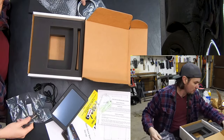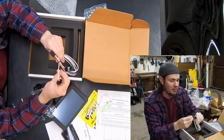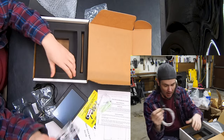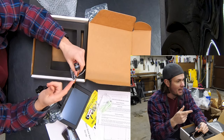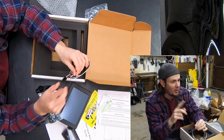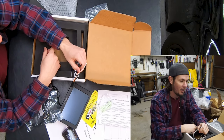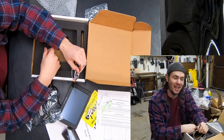What's different between the CAN adapter that's in the car and this one is that this one has two flying leads for power and ground to send power and ground to the dash. I want to dig into the harness we have in there right now and run power off of our auxiliary fuse bank — right there in the hood — then stretch the cables out and fire this thing up.